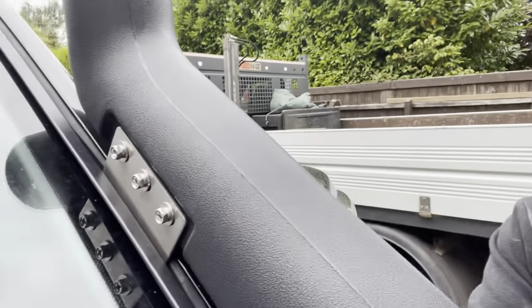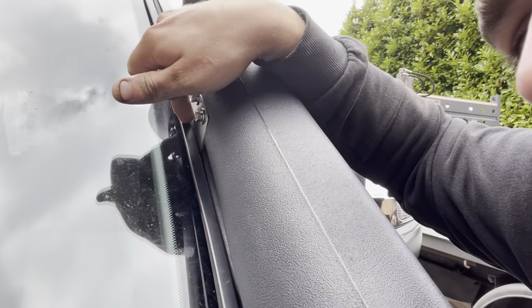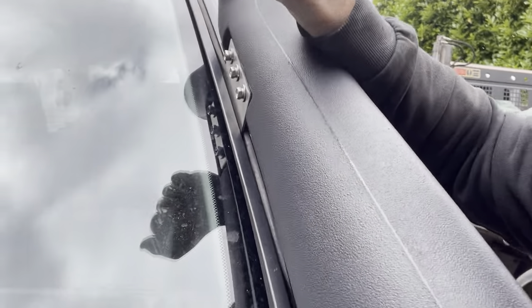There's the pipe at the top — all on the back edge. We've got rust, we've put some Hammerite on. As soon as I get this air box done I can start putting it back together again. The snorkel's actually on. Now I know I didn't show much of the windscreen pillar drilling — that's a bit rare to be honest. The bracket that came was, in my opinion, the wrong angle — slightly. So I adjusted it by bending it to what I thought was right and it paid off because it actually fits alright now. I did have to cut part of the inner trim bit, but you'd never know it now. That's something nobody tells you about.